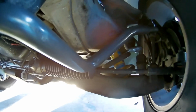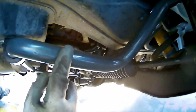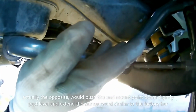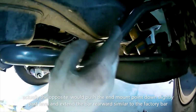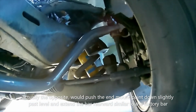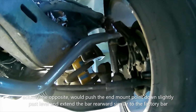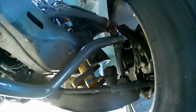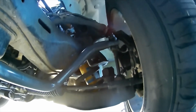And maybe I'll repurpose this sway bar. Maybe I'll repurpose it for my Plymouth. So what I was thinking, even if I were going to try and use this again on the Dodge, if I were to take like a 100-ton press or a whatever ton press and kink this right here where it bent this part of the sway bar up more, it would put it more into this area of the frame where it's supposed to be, and it would also change the angle, the approach angle of where it meets the sway bar end link, and that might even be enough to make it much more effective. So I don't know, I might try that. We'll see if time permits. So let me get started with this, and then I'll start back up when I get to the bounce test portion.